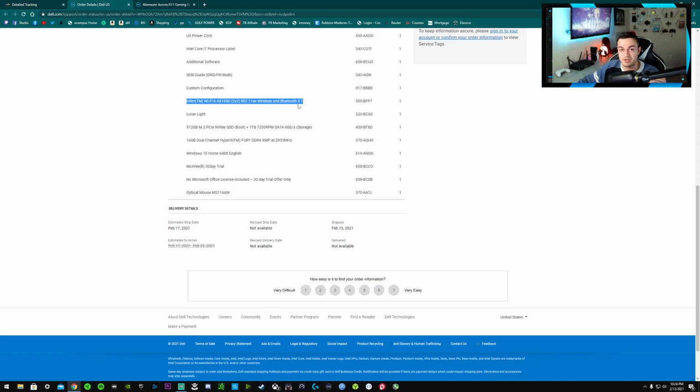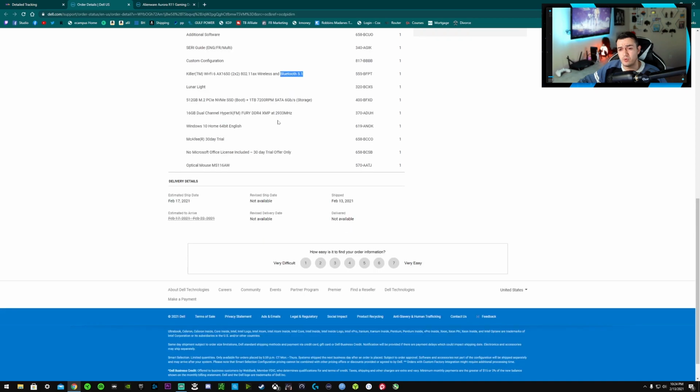Obviously, one of the first videos I make with this thing is going to be benchmarks for the CPU in Cinebench, and then also GPU tests and Heaven, and just different Unigine graphical tests. And then I'm also going to run some internet speed tests with the Wi-Fi and the Ethernet as well. It does have Bluetooth 5.1, which is pretty cool. Storage-wise, I went with a 512 gigabyte M.2 PCIe NVMe as my boot drive, and a 1 terabyte traditional old-school mechanical hard drive for storage.